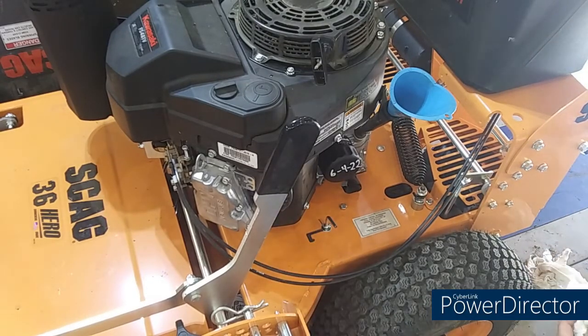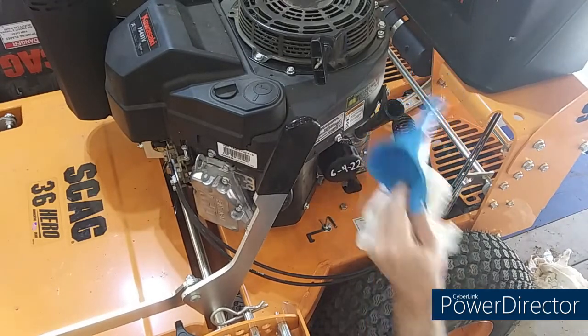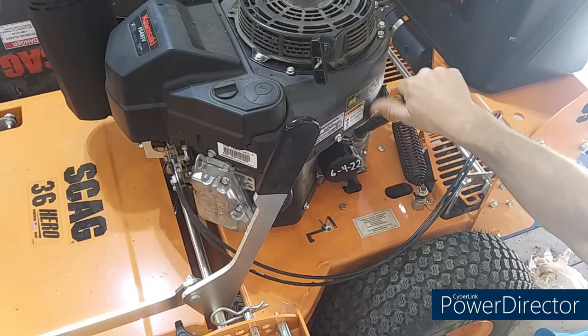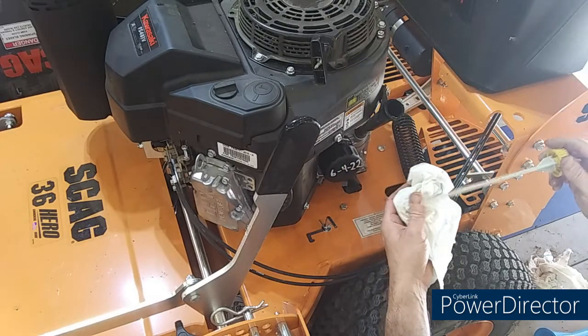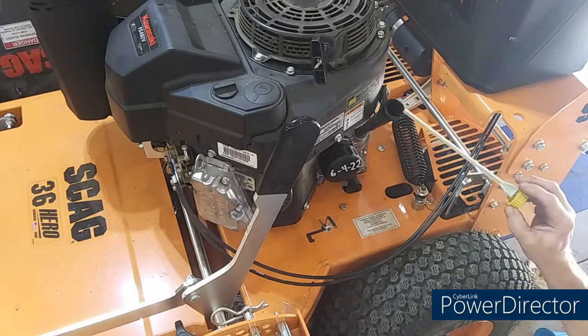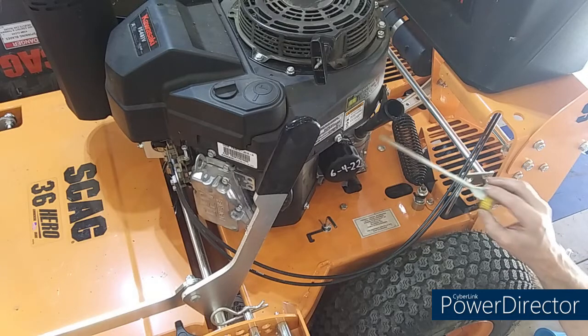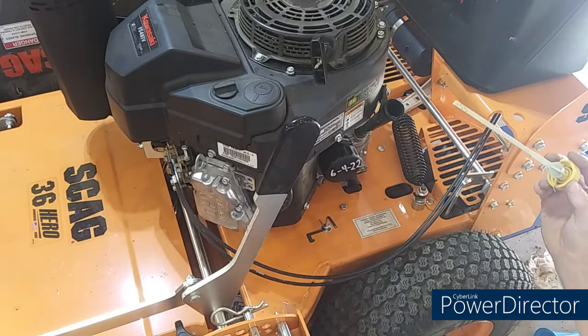Crazy expensive. I'm gonna see where this thing is on the dipstick on 1 quart. I don't wanna overfill it and waste oil, have to suck it back out. Because too much oil is just as bad as not enough. And of course, it's not even touching the dipstick. After I pour oil in there, I like to let it set for a good minute. Let all that oil get off the sidewall of the filler tube, because it will give you a false reading.